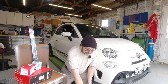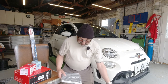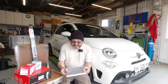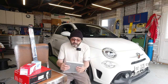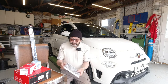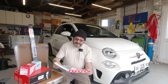We've got a cabin filter — this is a Febi Bilstein item, basically a charcoal-impregnated cotton filter. My experience is these come in two qualities: OE contains carbon or charcoal, and some aftermarket items are just folded paper. As long as it contains some carbon it's going to be as good as OE, and that costs about £7 in the UK.